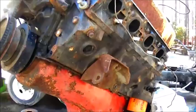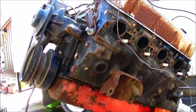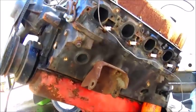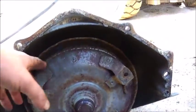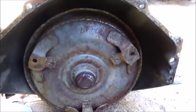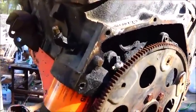What we're going to do is find out what it is and either way we're going to use it. We're going to run it with what's there. Later on, you can get a new set of aluminum heads made in Australia for about $900 and we may do something with that later. But for now we're not changing a thing — clean it up, paint it a little bit and seal it up. I went ahead and pulled the transmission off. I want to show everybody what a bagger torque converter looks like. It's a 10-inch converter with a shield around it — I think it's actually a shield to bring cool air in. That's how you can spot a bagger converter real quick. They're good for somewhere between 2,800 to 3,000 RPM stall, which means it doesn't take off until it hits a higher RPM — that way you get your torque and horsepower up. We're draining oil right now, getting ready to take the pan off.